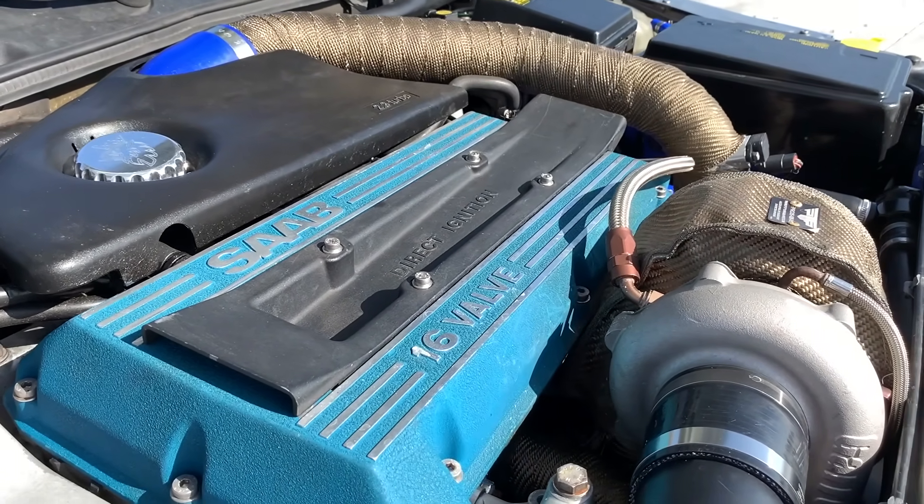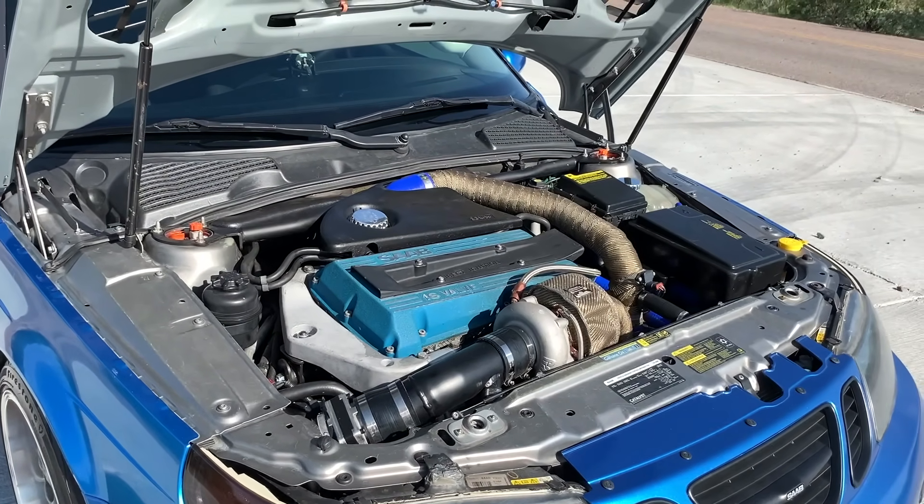You can get into a lot of trouble with this car for sure. It's very easy for it to get away from you and it likes to throw the needle on the boost gauge all the way off the end. Even before you really get into the power, it sneaks up on you pretty well. It has such a unique sound to it too because of that wastegate dump. So right now it has an open wastegate — the wastegate controls the pressure going to the turbo. When the wastegate vents the excess exhaust gas, in a stock car it vents back into the exhaust, but in this setup it dumps right in front of the oil pan. That's why you get that sound — almost sounds like Chewbacca.